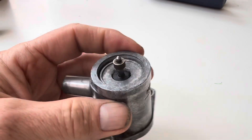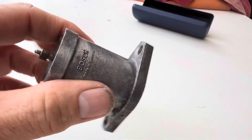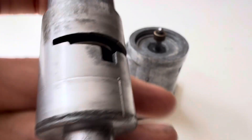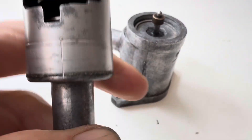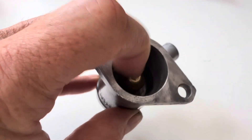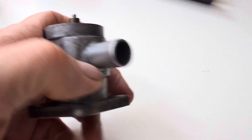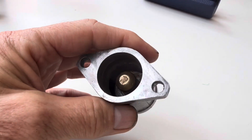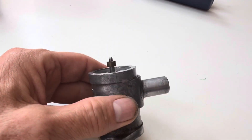I have a theory that over time the wax inside these bulbs loses its expansion properties and this rod does not move up as much as it should. The consequence is that you are still getting air in the engine as it heats up — this gap is not completely closing. It just so happens that you can still get these little wax-filled bulbs from the Bosch Classic Centre in Germany. They're not cheap — about 130 euros — and there may be a markup from a Bosch service centre. But I'm going to attempt to get one and compare the travel on a new bulb versus an old 40-year-old one.